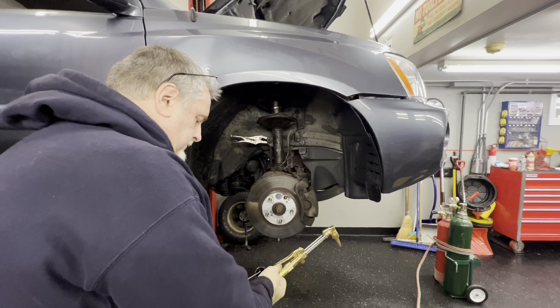We get this off, take this out, move this line off to the side. We're going to heat this thing up and we've got some vise grips that we're going to clamp on the inside and heat this nut up. Now these links are pretty inexpensive, and if you're doing it, you probably could get a new set of links. We're going to leave this one — if we get any type of rattle afterwards we'll replace the links. So we're going to heat this up and zip it off. It's a 17 millimeter, but it seems like it swells up a little bit and we end up using an 18 on it.